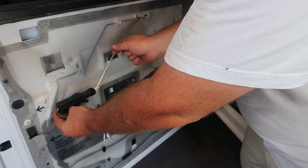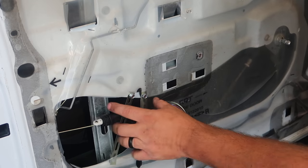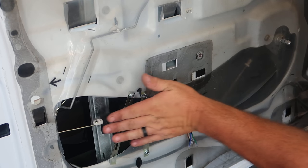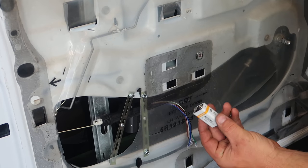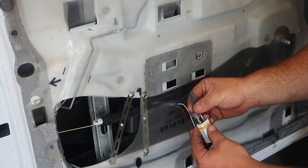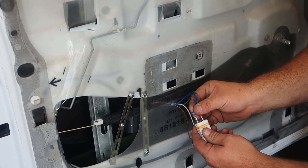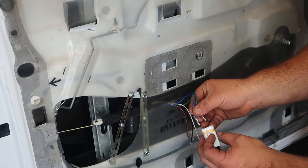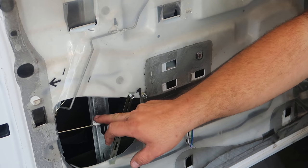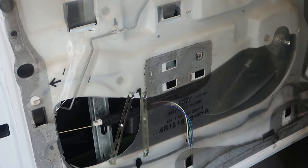We need to find a mounting spot for the actuator and how we're going to attach it. I have the actuator mounted and attached to the rod, making sure it's as parallel to the same motion as the existing rod. You can test this with a nine-volt battery using the blue and green wires — just go positive and negative, then switch the battery around to test lock and unlock. I also mounted it with the window all the way down to make sure I had enough room inside the gap so it doesn't interfere with anything. I also removed the door handle to make sure I had all my bases covered for the mounting location.